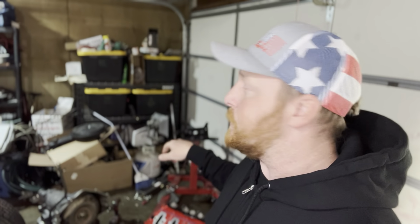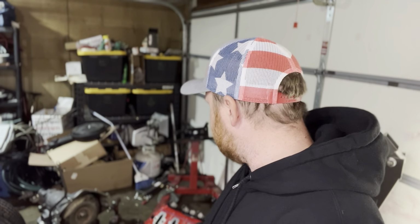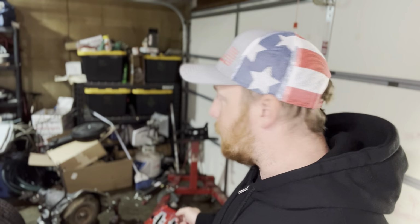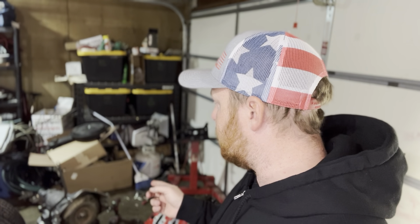But as you can see behind me, the engine stand's empty. I actually got the engine on the ground now, and I'm gonna get ready to mate it to our transmission. We're gonna use our ICT billet adapter and flex plate that they provide to mate our Turbo 350 to our LS. So I did a little bit of modifications to the transmission dipstick.